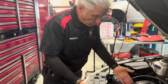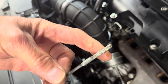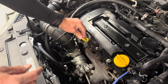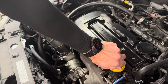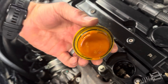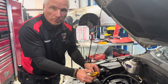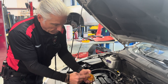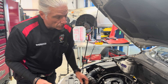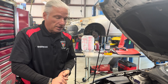Let's look at this one — it's clearly got a blown head gasket. We're always taught to look at the oil and it'll be milky. Well, that oil is not milky — that's clean, nothing wrong with that. Also, if it's blown, a lot of times moisture will get into the crankcase mixed with the oil and the oil cap will have all kinds of milky, oily residue on it. That doesn't have any sign of that. So some obvious signs of a blown head gasket would be milky oil or milky oil residue up here — but this one doesn't have that at all, and it clearly has a blown head gasket. Sometimes the old school signs are there, cut and dry. Sometimes they're not — you've got to use a little technology to find out what's going on.